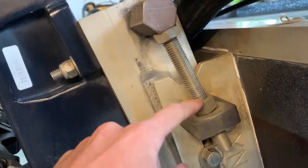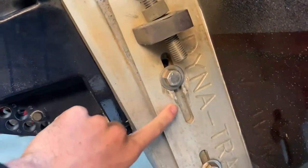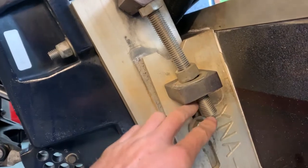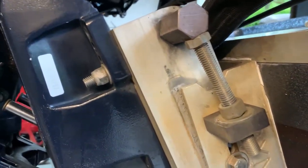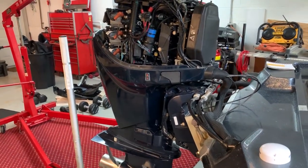This one's twisted, it's not cracked, but it's also missing a nut down here and you can see how much that jack plate's been moving, which is not good. You see it all the time and it never occurred to me to check to make sure the bolt is on the bottom or make sure there's not a crack in there. I think that happened when I hit a sandbar over a year ago and it's been doing fine, but obviously we want to get that fixed ASAP.